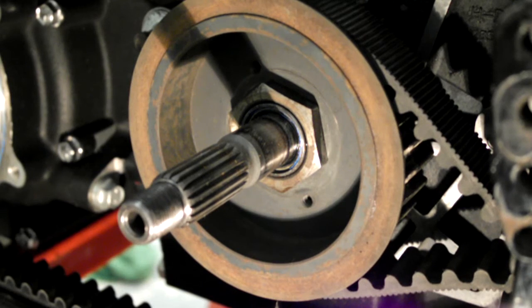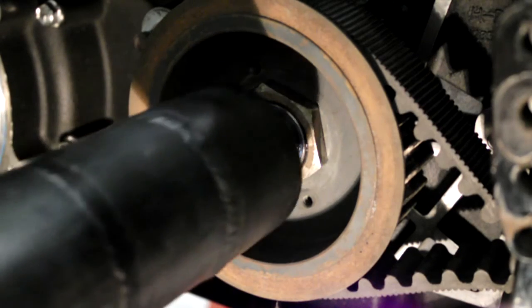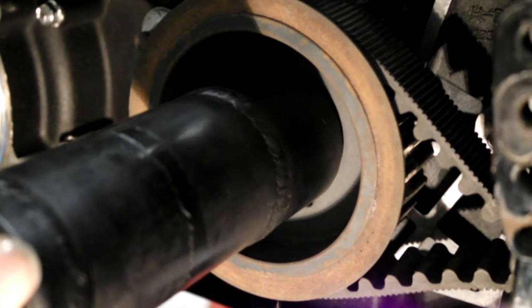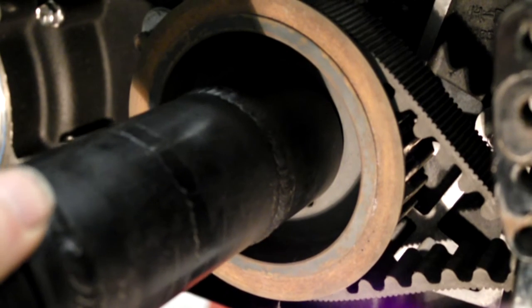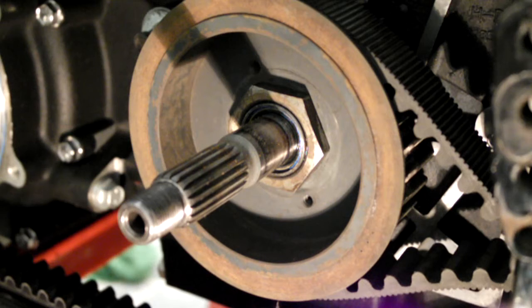Right, the torque setting for this is 81 newton meters, but after you've torqued it, you then turn it so many degrees, in between 35 and 45 degrees. Right, and that's that torqued, 81 newton meters, or, just have a look at my torque wrench, 60 foot pound.